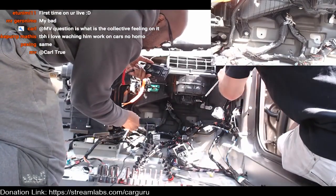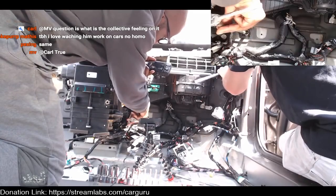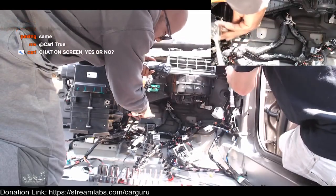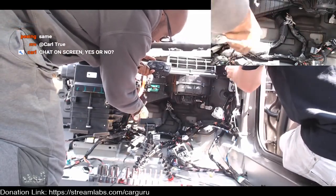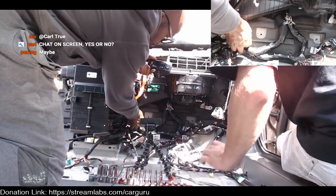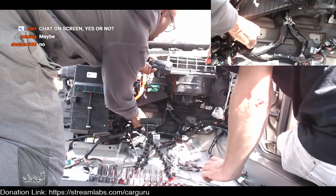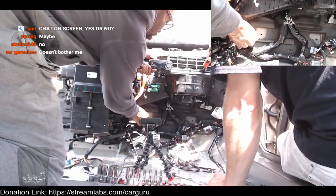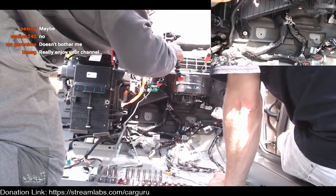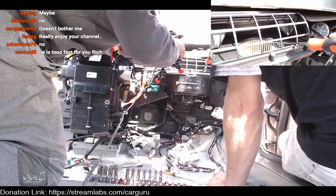I tried to spin the motor over the other day, and it seizes, the lower motor. Yeah, it seizes. It looks like the water got to it, definitely. Check out the camera, put it right in here, and I think you can just barely see. Oh, yeah, wow. The bearings are definitely gone. That motor needs some help. I'm pushing pretty hard to get it moving. Yeah, it's done.